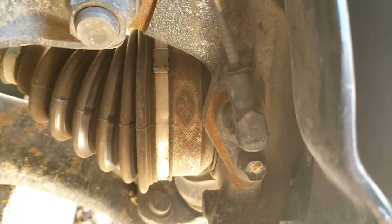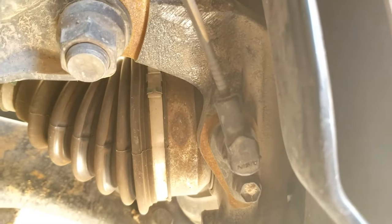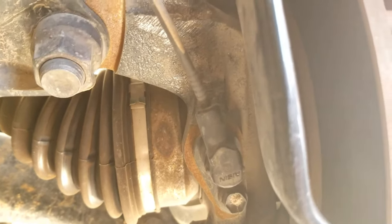I need to test this wheel speed sensor, so I thought I'd make a video on it and show you how you go about testing these wheel speed sensors with the multimeter, which is pretty simple to do. You basically just test them for ohms, so first you need to find the other side of your wire.